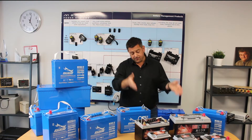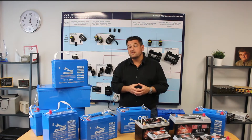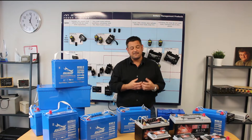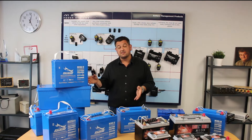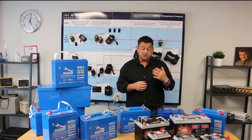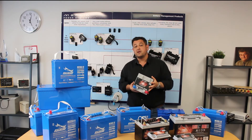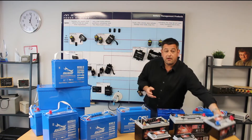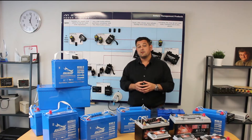You'll see two ranges here. We've got the Full Throttle batteries — these are a thin plate design. Thin plate equals greater surface area, which means that we can generate instantaneously very high levels of current. Then we've got a thick plate design which is the DC series, designed for deep cycling. Within the Full Throttle range, our small FT410 battery will be enough to start a six cylinder diesel engine. They're great for use with bow thrusters on boats, winches on 4x4 vehicles, or operating a passenger winch or lift on the back of an ambulance.